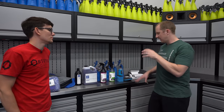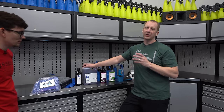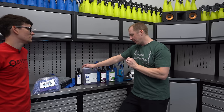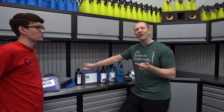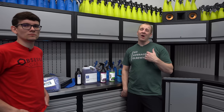We're going to do decon here first. First thing is wash it with my decon soap — a tunnel wash type, alkaline, pH of 10 and change. The magic of this stuff: it foams incredibly well, it's not super harsh on your hands, does well in the bucket, and has plenty of lubrication. A lot of my decons are followed by just a one-step finishing polish, so why add scratches if we don't have to.